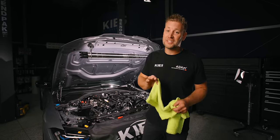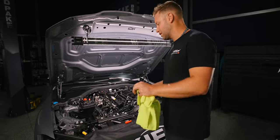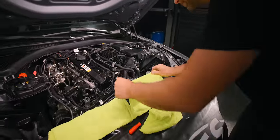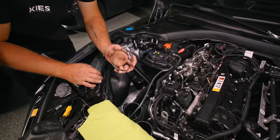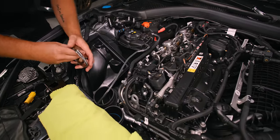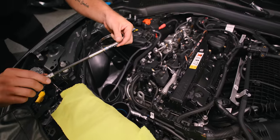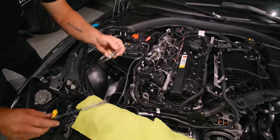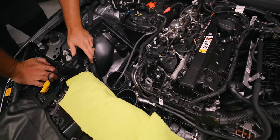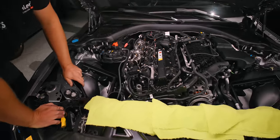Next, we want to make sure that the carbon does not get scratched. As you can see, there are a number of pretty sharp areas, so we're going to take some microfibers and lay them down to prevent any damage. Next, take the smaller clamps and put them on the inlet. Now it's about to get really tight really quick, so I would recommend using a 7 millimeter — it's going to stay on a lot easier than using a flathead, especially with the awkward angles. Go grab the intake, line these up first, make sure that this is good, and then line everything else up and start to tighten everything down.